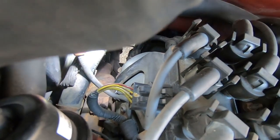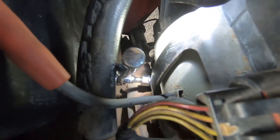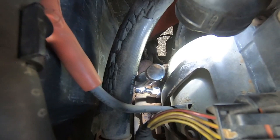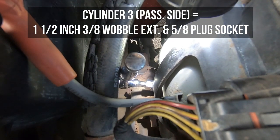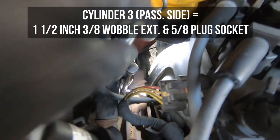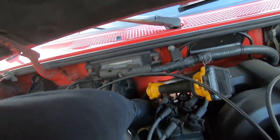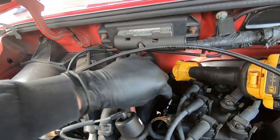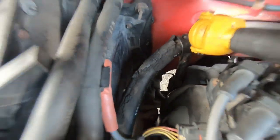Let's get that last rear plug on the passenger side out. I got the socket wrench on it already — dropped it down the same way I popped the wire off. I'm using the same extension setup as the last plug: the little one inch wobble extension on the 5/8 spark plug socket with our 3/8 drive ratchet. Not a lot of room here and she's a little tight because of this hose, so you just have to get the socket wrench in the right spot so you're not pressing up against it. There we go — got that loose.